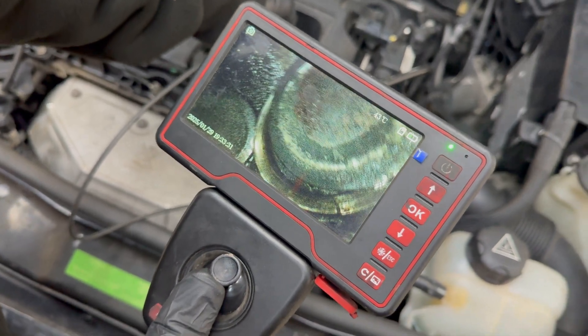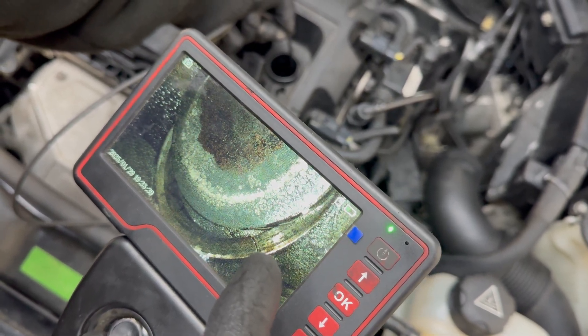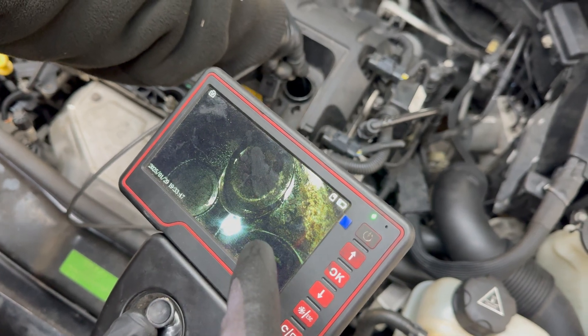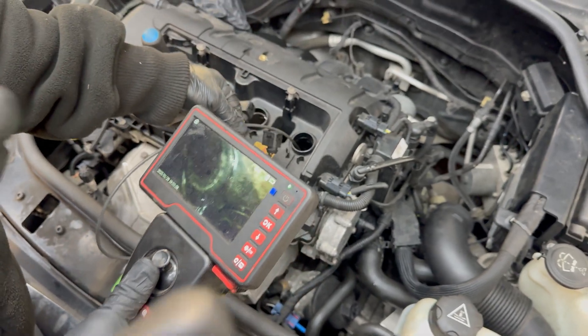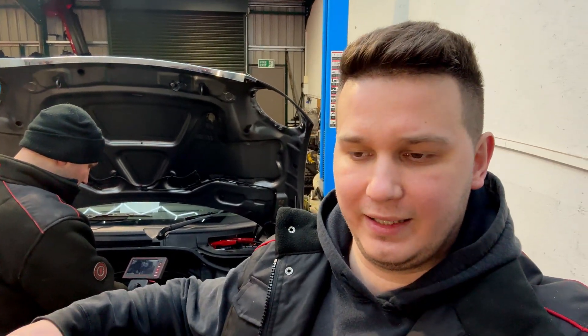As you can see, we can see it from underneath. Also, you can see the crack there — that is the valve seat cracked. And I would say it is out of its position, so that has moved. The valve seat is not sitting properly where it should be. Now we can confirm that the engine has serious damage and the cylinder head has to come off. Our suspicion is: because the engine got overheated, the cylinder overheated as well and the valve seat fell out of its position. As the valve was opening and closing, it just jammed and cracked it. This engine needs a rebuild, which we are going to carry out.